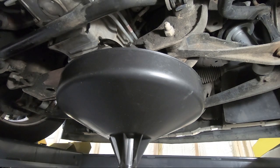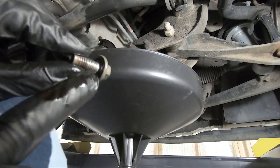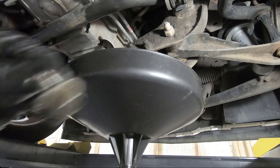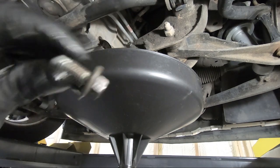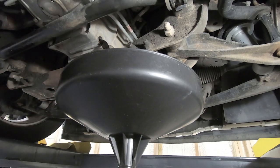The truck's kind of warm, and I like to change it when it's warm because it comes out quicker — the oil is nice and warm. The other thing you want to check once you clean this off is make sure that this gasket here that seals up against the pan is good. Mine is still looking good so we're going to reuse this. If it's crushed down, I'll list a new plug in the description. Or if you have a newer version that has a removable seal, you can just replace the seal. We're good on this, so once this drains, we'll move over to the filter.